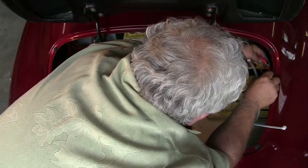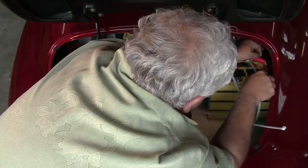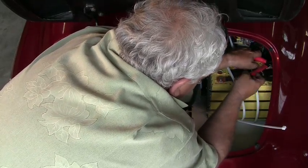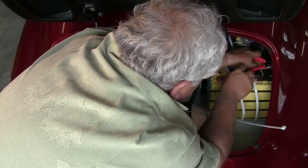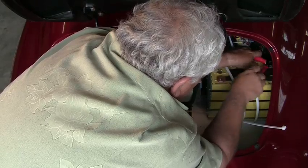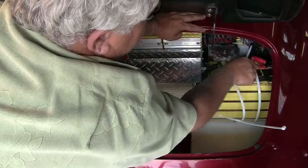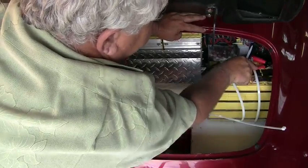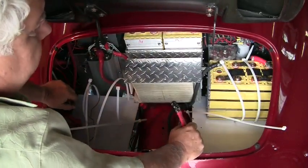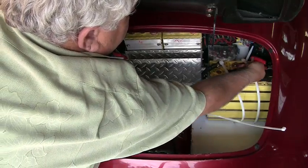I'm going to check all your connections — make sure they're pretty snug. One of the biggest problems is loose connections. If they're a little bit loose, and they will be with the thermal heating and cooling, they'll get a little bit looser. You want to go around once a month and tighten all your connections. Current flows in this car typically at 500 to 600 amps.